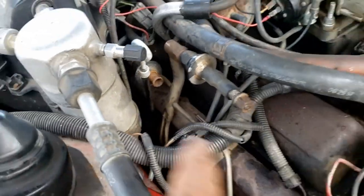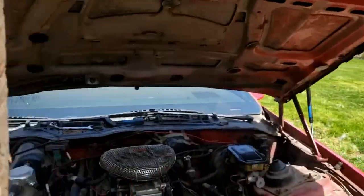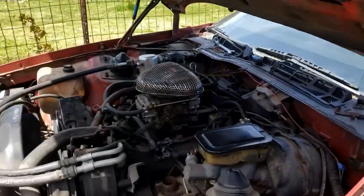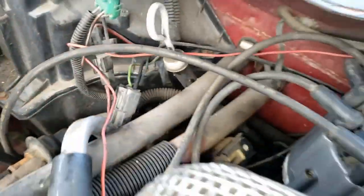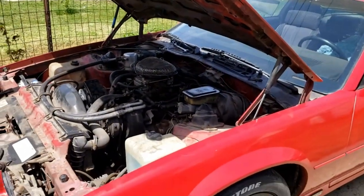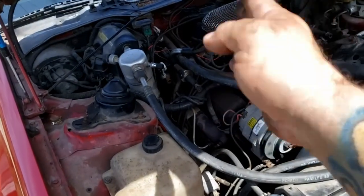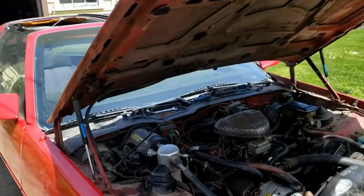And then there's still that valve down there on the exhaust that I gotta put headers on. Yeah, put headers on, right. But I'm gonna fix that exhaust leak. If you listen, you can hear it. That's because of that valve not being able to open or close, so we're gonna make it stick open and weld that leak where the pipe is cut right by the Y, and that'll shut this thing down and it will sound so much better.